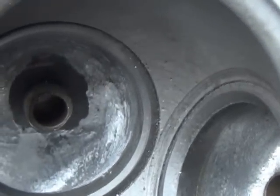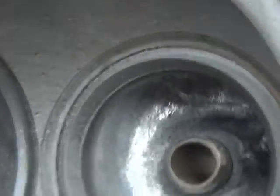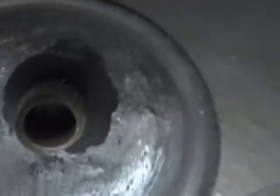We'll do a little seat work next and do a valve job, put some guides in it. I've got a little bit more cleanup to do right there at the bottom of the hole where the valve guide area is — that dark area is where I have it ground. We're going to smooth that up a little bit. It's pretty smooth now through here, and you can stick your finger right on through here pretty easy. Even come around this tight turn right here and get some airflow around that corner.